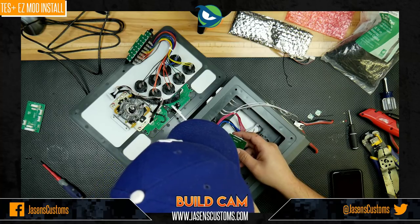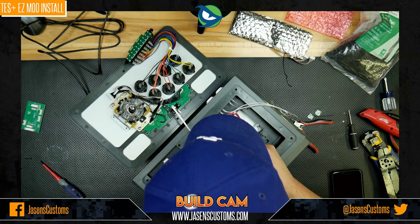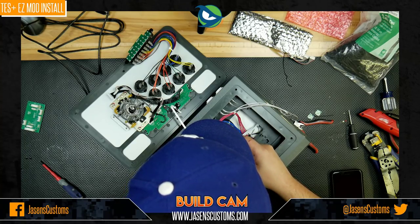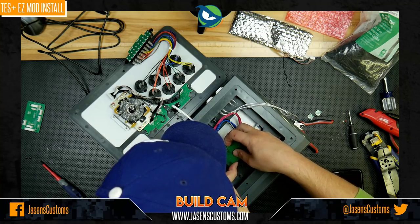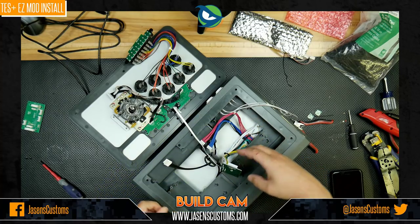And that's not straight at all. You want to make sure it's in there straight, because if it's not, you won't make connection with all the pins on the little ribbon. And you definitely, the contacts will go up, so they're facing you. Okay, a little snug, snug, snug.